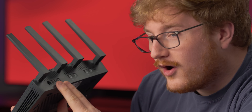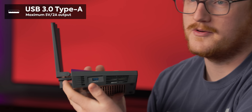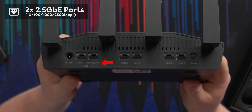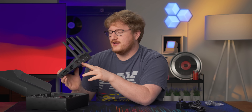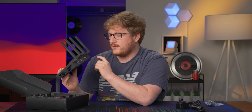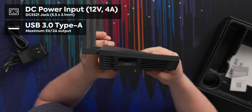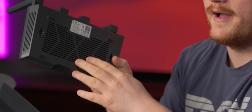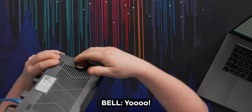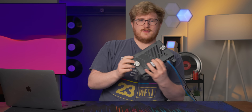You can use a hardwired WAN, two hardwired WANs, or connect cellular to it. There's a USB port to tether your phone. Those two hardwired WAN ports are both 2.5 gig, and you can switch each between WAN and LAN, so you could pass a faster-than-one-gig internet connection to a device or switch. They've also got four more one gig ethernet ports for most of your devices, a 12 volt DC jack, and a USB 3 port on the side. It's got keyhole mounts so you can mount it on the wall, or with the LTT cable management product — stick it in, tighten it, and it's magnetic. Bam, cable managed. You can mount it right to the back of a PC case.